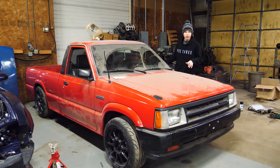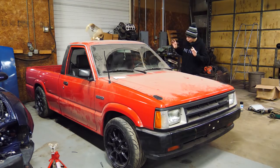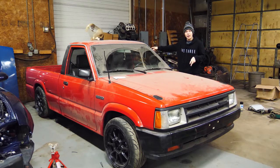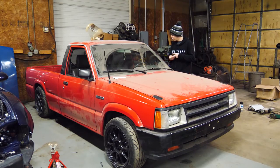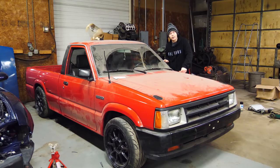This truck is pretty light from the factory. I couldn't find an exact measurement but the curb weight range is from 2,300 to 3,000 pounds, so even at 3,000 pounds it's still really light. We did a couple things during this swap to make it heavier — the engine's heavier even though it's all aluminum, and the axle is a little bit heavier than the stock one. We also removed some weight: the exhaust is lighter, the driveshaft is lighter, and it has less front-end suspension components — no torsion bars. So I'm really curious to find out the weight and weight balance.